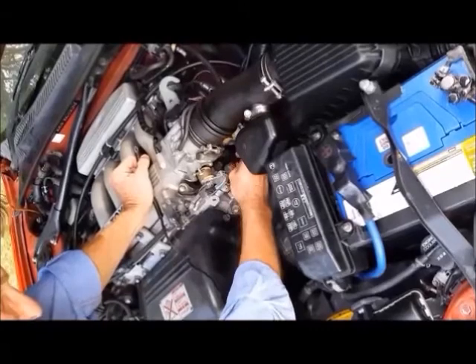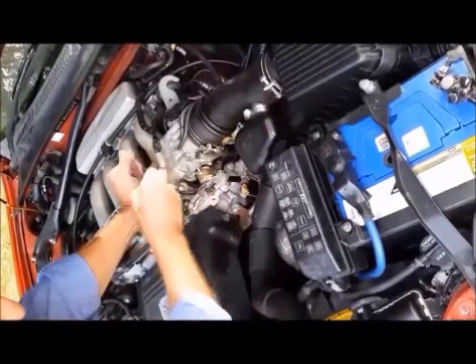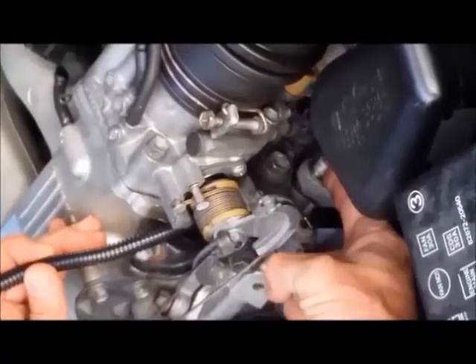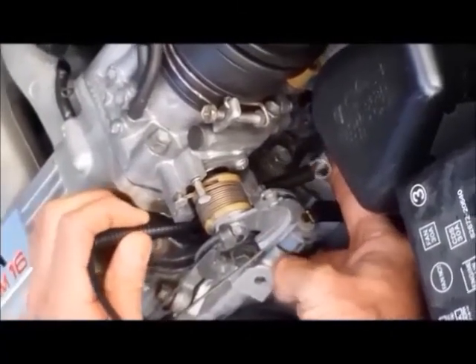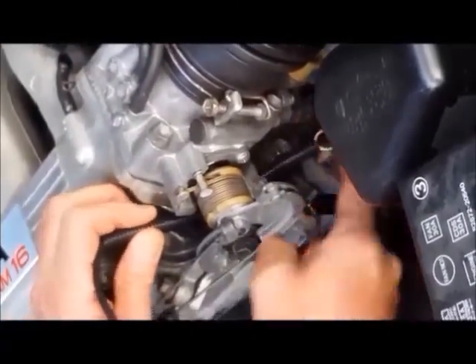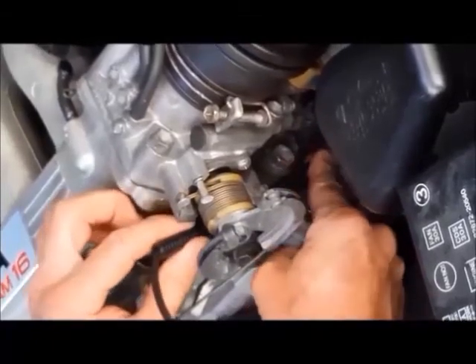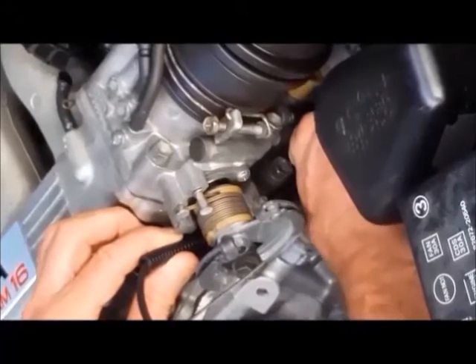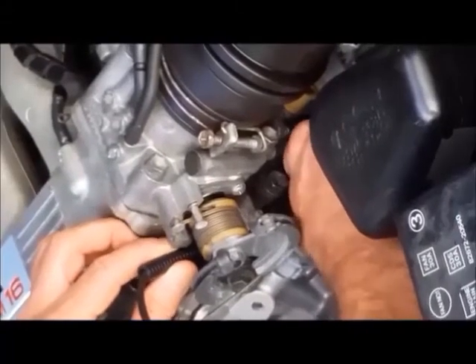Here's a great location: we're going to put it underneath the nut that goes on the stud directly into the cylinder head — excellent heat transfer at this point. As you can see, I've taken the nut off, so we're going to slide the sensor over the top of the stud just like a washer. Now all we need to do is return the nut and re-torque it to factory specifications.